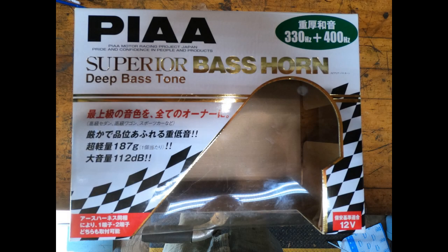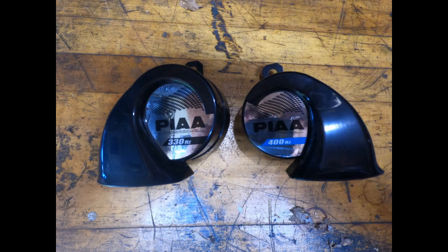The easiest way is to press the horn button and keep on listening. The horns I chose to use are from PIAA, P-I-A-A. I got them on Amazon — they're about $42 a pair, and they are light, compact, and really loud. The other advantage is they don't draw much current. Together, the two of them draw about 5 amps.